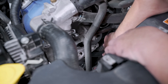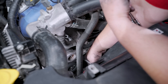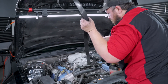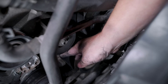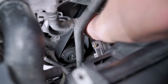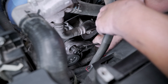To remove the supercharger belt, we did have to unbolt the 15mm bolt on the tensioner from the front end. Once this is off, you will be able to remove the belt off of the vehicle. Route the new belt on the lower crank and the AC compressor. Then reinstall the belt tensioner using the 15mm socket, and reroute the new belt in its proper orientation. Depending on your vehicle, these applications can vary. Check out the link in the description below to see how your belt will need to be routed.